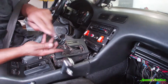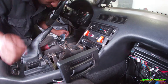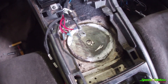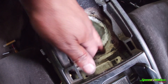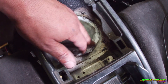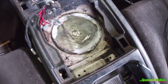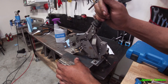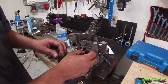I'm going to take the shifter out and show you. Below the shifter, I made a round circle plate out of roughly quarter-inch steel and stitch-welded it in, since the surrounding material is super thin. I used some bath sealant from Home Depot and the plate bolts up to four 10mm bolt sections around the circle. Now with the assembly in the vise — neutral, one, two, three, four — that's fourth gear.